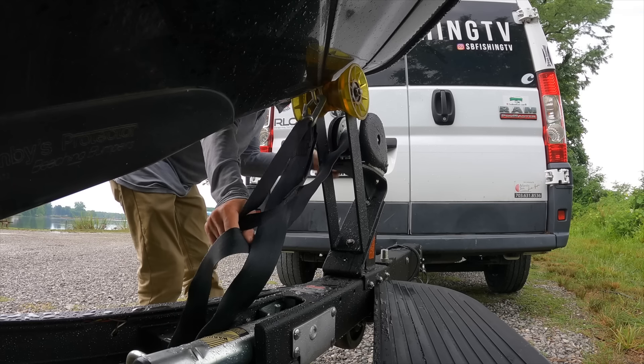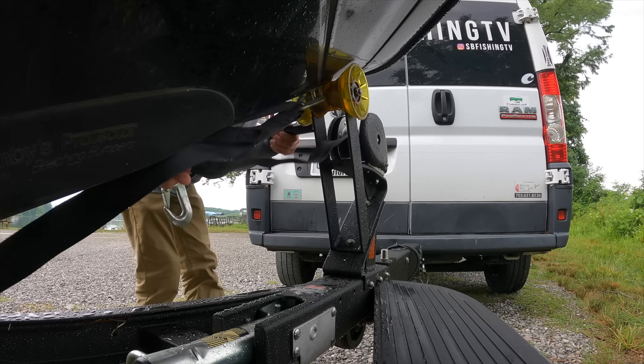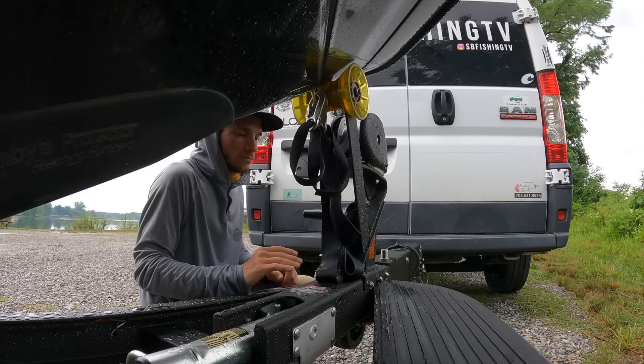You guys know that I mainly fish out of a john boat — launching them is pretty simple, much smaller boats than a 21-foot Ranger. What I'm gonna do to solo launch is give myself five or six feet of slack on the crank, let that hang so it doesn't drag on the ground or get caught on anything. I've got everything unstrapped in the back, hit both tie downs, took the transom saver off, removed the two little tubes that slide over the trim pieces. The boat's loaded up with rods and tackle. Last but not least — and you can't ever forget this one — the plug. So we're gonna get this boat in the water for the first time.